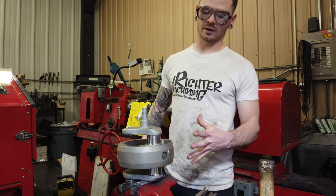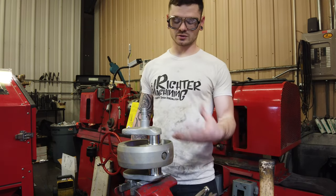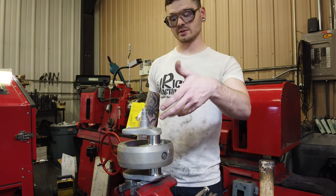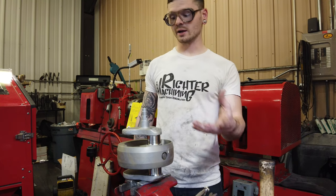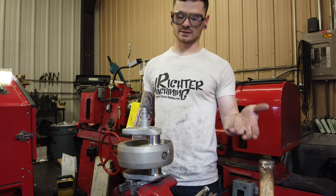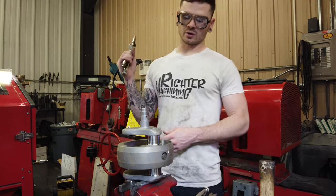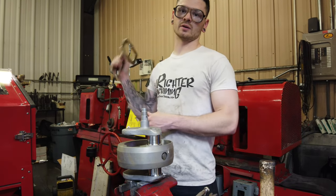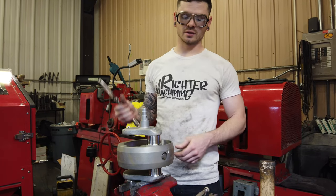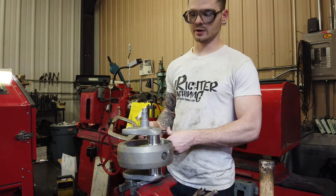Also, cleaning them up. I spend way too much time just trying to degrease some of these because they're so filthy. The sludge trap itself is always like a rock in there, and then a layer of baked-on nasty black sludge all over the whole thing. It takes me a while to get it cleaned up. So if all I have to do is throw it in my grinder and grind it to the next available undersize, I can cut the cost to the owner by a lot. So, just something to consider.